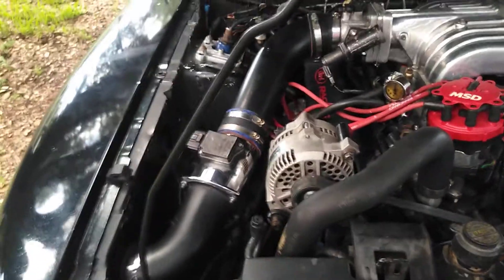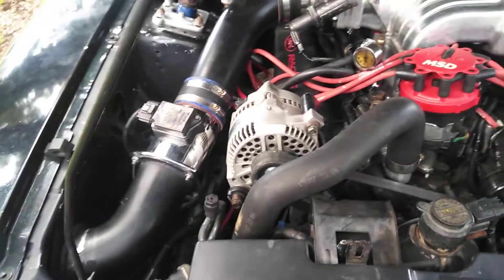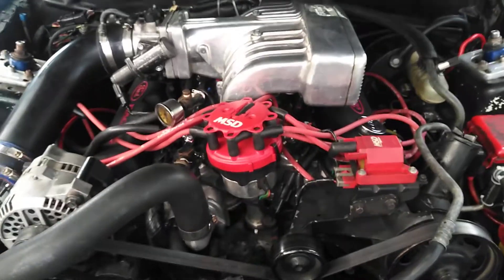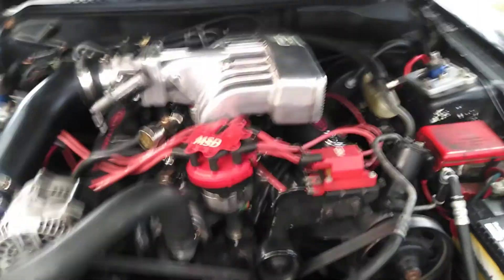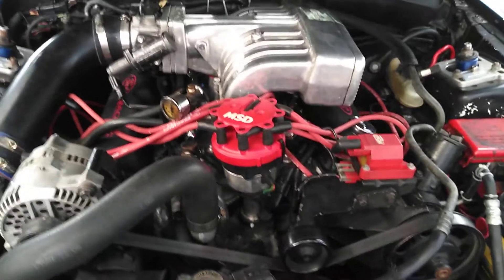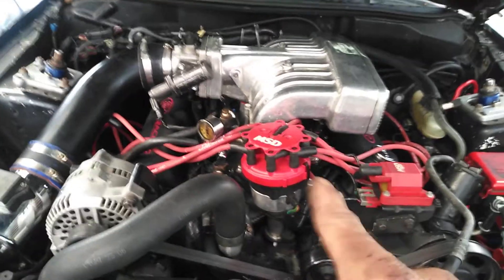I don't know if the O2 sensor is bad — I have cleaned the O2 sensor, I've tried that many times. I don't know if the car needs a retune. It definitely has multiple vacuum leaks. My next step is to take it to my buddy's shop and use his vacuum machine, and this week I'm going to go ahead and get a wet and dry compression test to figure out what's wrong with this motor.